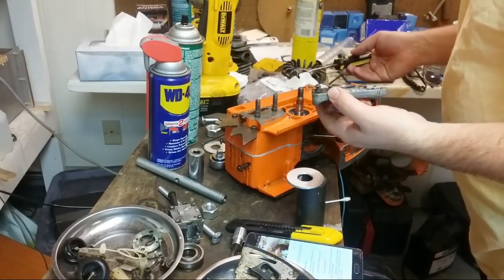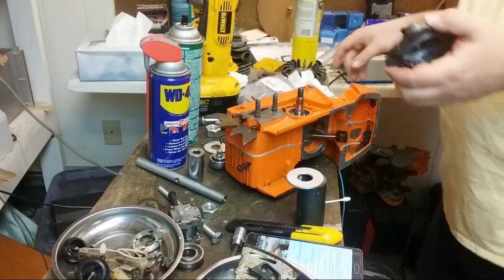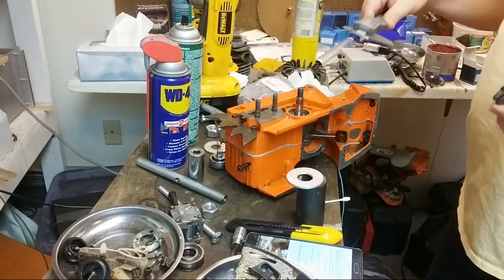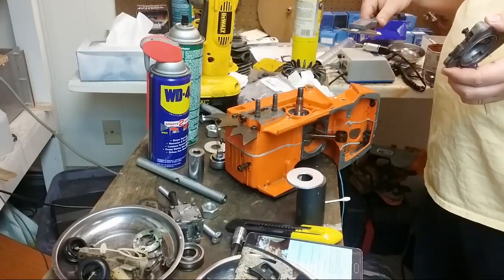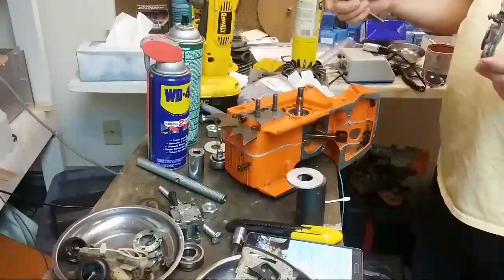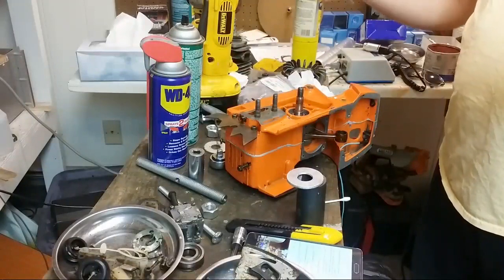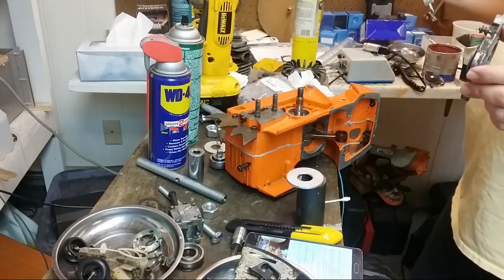The X-ring stayed, that's fine. The O-ring's fine. But you know what I didn't do that you should do? Measure that. 5.31. So this is about 4 millimeters. This is a tad deeper, 4.43 from that lip.